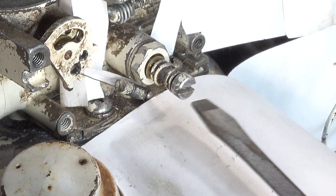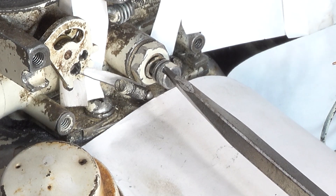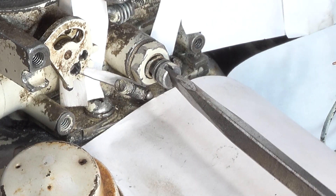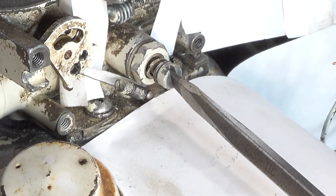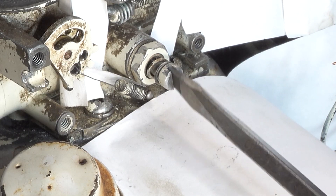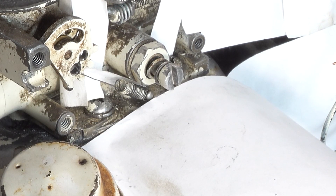So this goes right in here next. We're going to screw this guy all the way in. Once we reach the back, you don't want to crank down on it really hard, just get it kind of snug. Then you come out one and a half turns — this is a half turn, this is another half so we've got one, then we go one and a half. That's set up so it should be able to start, and then you'll fine tune and adjust it after that.